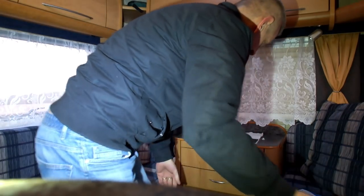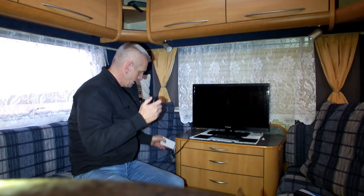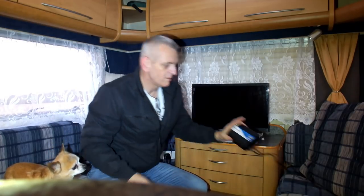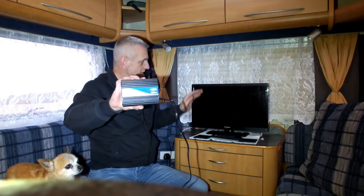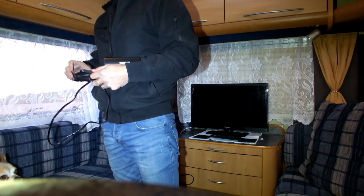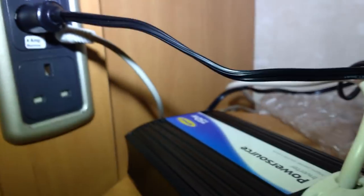Come on Benji. Now let's get the TV - I'll keep it there. So there's the TV. Extension lead from that cupboard to there, plug it in. Aerial wire obviously from the aerial. We've got - it's actually a 150 watt inverter, I thought it was 100 watt, it's 150. That TV is 45 watts. So what we're going to do - plug this in. I'll show you this cigarette lighter so you'll know what it's going into - it's going in there. It has USB on the front as well as the plug. If I plug that in you'll hear the fan come on - there, that's the fan.